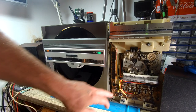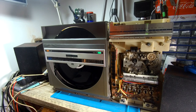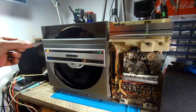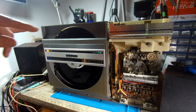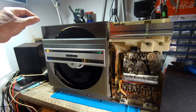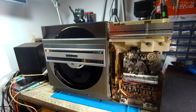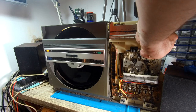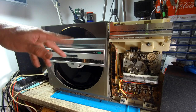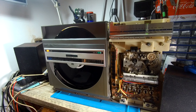Use that button to move the stylus across - it's playing fine. Got your speed selection down here if you add a 45 in there. Everything's looking good. Flip it over to the other side of the record and it will now go over and play Side B, which is another stylus on the back. Now there is still a problem with Side B - it was playing quieter before and you can hear it's playing quieter again now. Side B is a lot quieter than Side A, still playing fine but it just hasn't got that bass to it. What I might try is swapping the styluses over - put A into B and B into A - and see if that makes any difference.